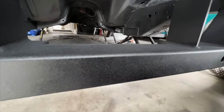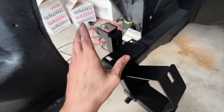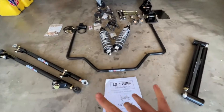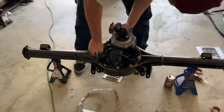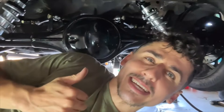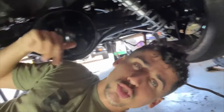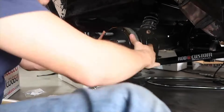I will take the motor out again and paint the full car inside and out when I'm 100% done. Next, we moved to the rear to install the Rod and Custom suspension with a John's 9-inch rear end and 3.80 gears — a four-link suspension with QA1 coilovers. Having Bryce, we decided to weld everything together rather than bolt-on, which made the rear end install a breeze. We have the John's Ford 9-inch rear end, QA1 coilovers, Wilwood disc brakes, and the rest of the components from Rod and Custom. I then did axles and brakes — coilovers slipped on and brakes bolted right up. This was my first time doing a rear end and rear brakes, and it was pretty easy.